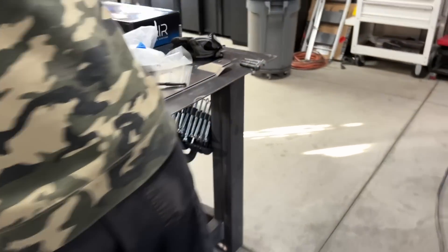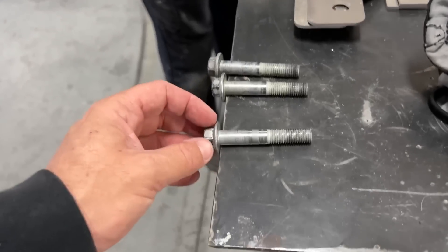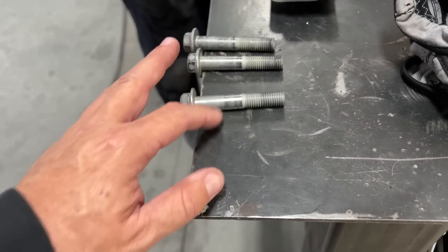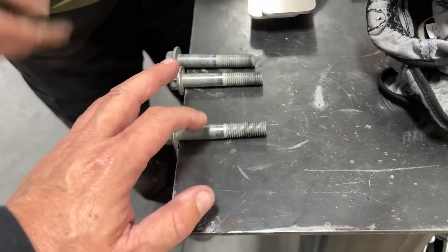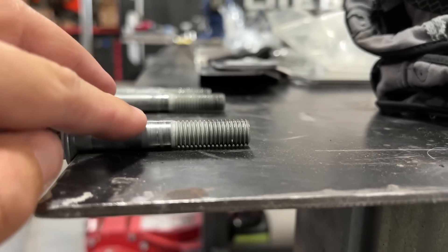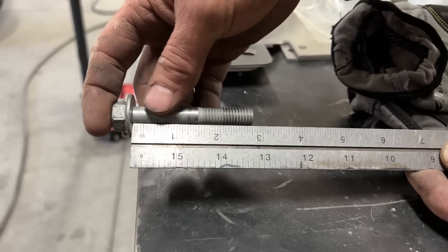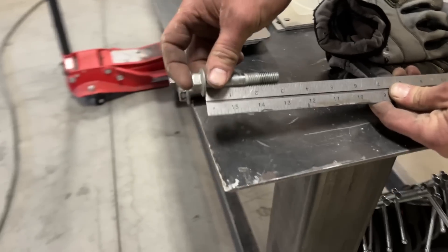So these are all out. Looks like I have a bent bolt up front. The shock went boop boop boop when I pulled it out - you can see it right there, it's bent into the end of the bushing. Good job Kevin - I mean, Chris. He'll rebuild those. So what do you want to do next? Oil change? We'll start mounting this to the AAL plate. These are just so pretty - they're compact and they work. Can't beat an ARB.